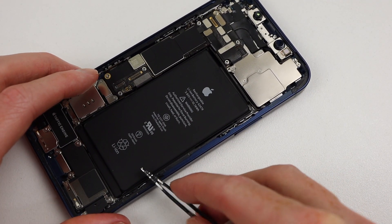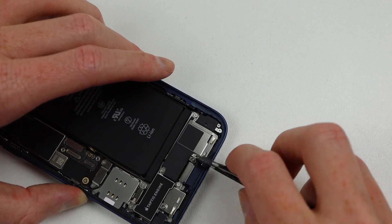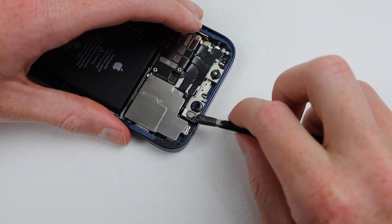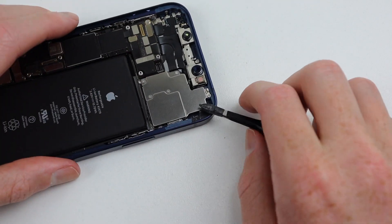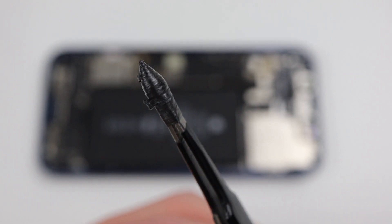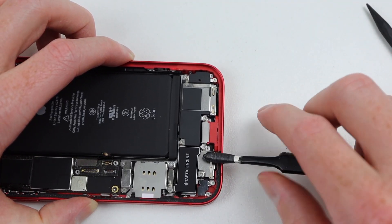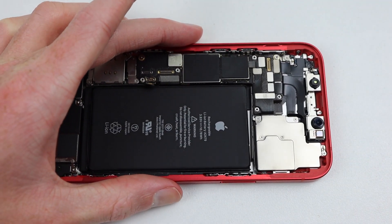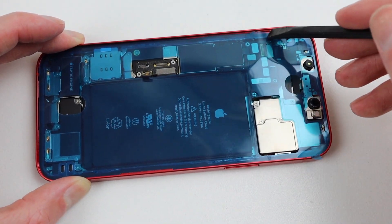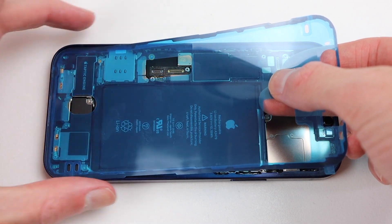The last thing I needed to do was reinstall the displays on both phones. I needed to install a new water and dust resistant seal, which I didn't do last time as this phone was so new there wasn't one available. I purchased a pack of 10, so I could install some on both phones. Using a pair of tweezers I was able to wind up all of the old adhesive in one go — an effective but time-consuming method, quite draining on the fingers due to the constant rotation required.